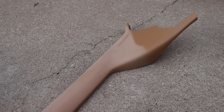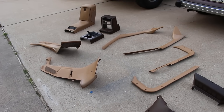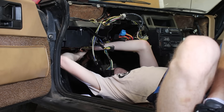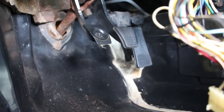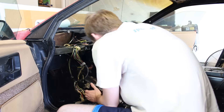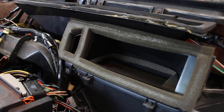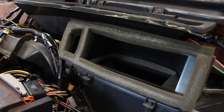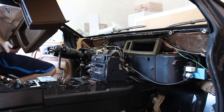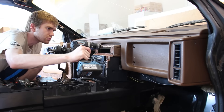There was some sun bleaching on some of the trim panels around the door, but that doesn't need to be taken care of right now. With everything clean, it's time for reassembly. The first thing back in was the clutch pedal — harder to install than remove since I had to fight the return spring — but eventually it was in and looked great. Next was the freshly rebuilt steering column: slipping the shaft into the U-joint, securing with a bolt, plugging in all the wires, and securing the column to the frame with four bolts. I then verified the ignition switch still worked and tested the climate controls. After unplugging and replugging the vent servo motors, they worked just fine, so I could put the dash back in. It's honestly really easy — just make sure the speakers are plugged in and screw down a handful of bolts. Done in less than 10 minutes.